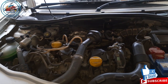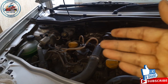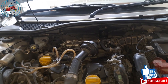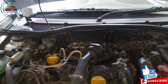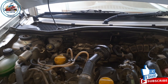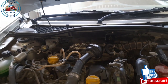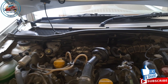Friends, we are done with the service of Renault Duster. We have changed the filters and the engine oil — that's the basic service I have shown you. Apart from that, you should check the coolant level and top it up if it's low, check the brake fluid and steering fluid, and also check the brake pads by removing the wheel to inspect how much pad material is left. If required, you can change the brake pads as well, which is also a simple process. If you like this video give it a thumbs up and please subscribe to my channel. Take care, bye bye.